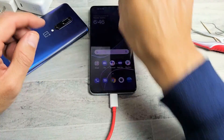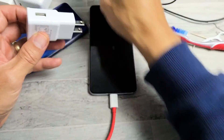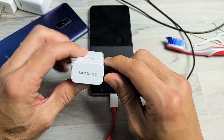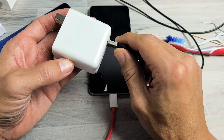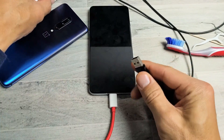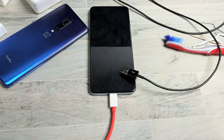If you change cables and it's still not working, then I would advise that if you're connected to one of these wall adapters, go ahead and use a different wall adapter. If it's still down, plug it into a different wall outlet. Also, take it out and plug it into your computer. Leave it in your computer for a while and see if it will charge like that.